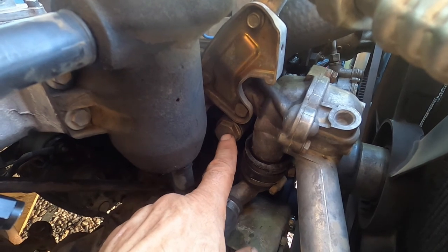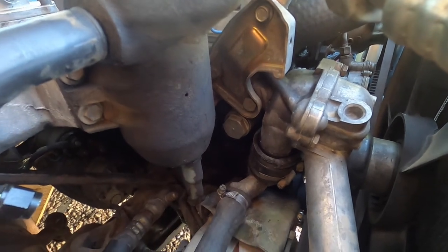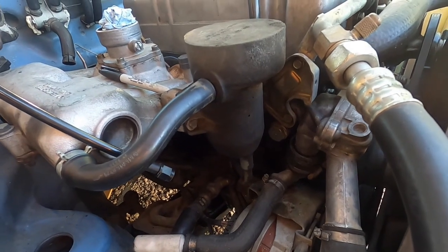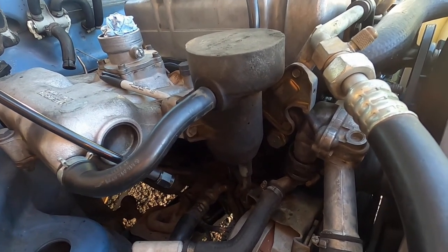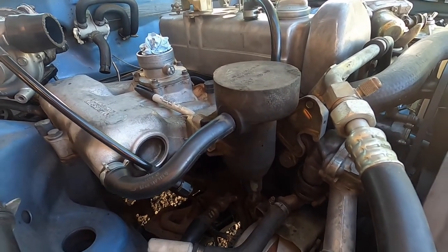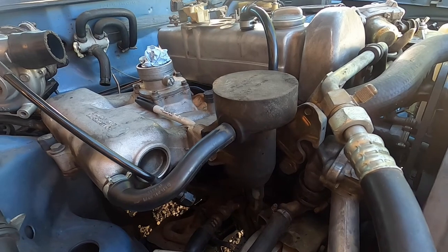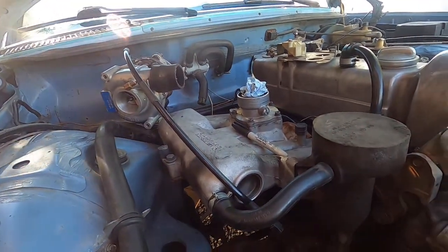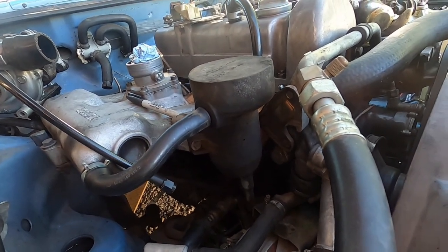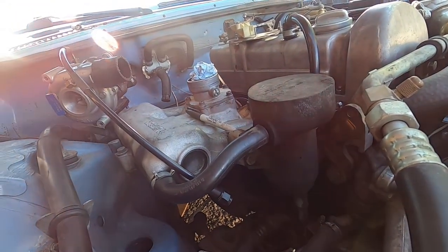Drill and tap that. What's going to go here in line is a restrictor, and that restrictor will allow me, and mine are variable, I sell them at Yearwood sometimes or online, for applications such as these where you need to reduce the oil flow to about 150 to 200, sometimes 250. This one I do around 200 milliliters per minute. And of course that increases with your RPM so that you don't overflow your oil and start pushing it into the turbo side.